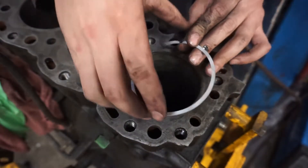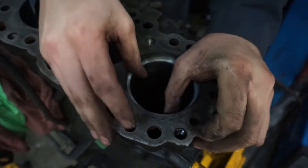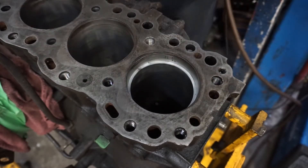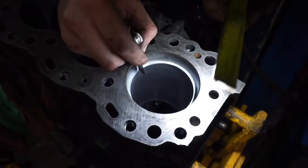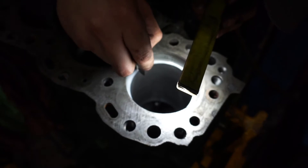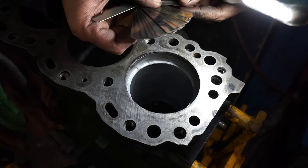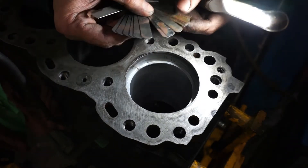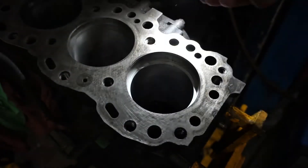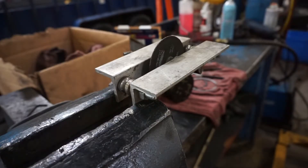This is a 1983 Toyota 2L motor — unfortunately it's not the 2LT that came turboed, but that's fine, we're going to turbo it anyways. Right now I'm setting the piston ring inside the cylinder. I'm going to use this piston just to make the ring flat, then grab my feeler gauges and work my way until I find one that fits with a tad bit of drag. I'm trying to go for 17 thou — typically for non-turbo you want about 15 thou, but for turbo I want 17 to 18.